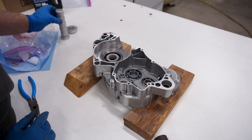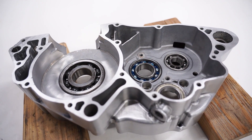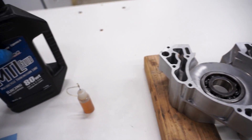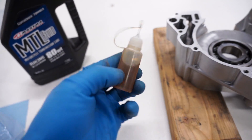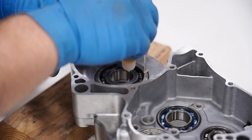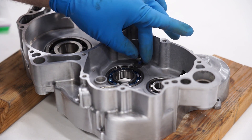That was pretty simple. You don't want to forget those retaining clips that hold the bearings in place — pop those in as soon as you can. Also, with the temperature difference between the bearing and the crankcase you're going to get condensation, so I'd recommend adding some gear oil or engine oil to keep things rust free. For the retainer screws, make 100% sure you put some blue or red Loctite on them — you don't want those coming loose.